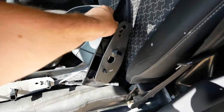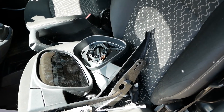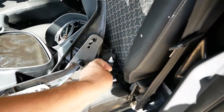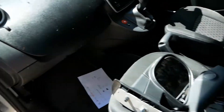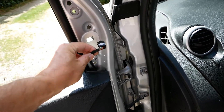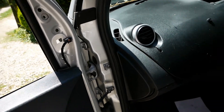There's no point having a mirror you can't even screw on — that lasted 30 seconds. I'll show you why: it's very easy to fit these mirrors. You pull that bit of trim off — it's held with just two clips — then you've got your two screws holding the mirror in, and you unplug the plug. It is literally a one-minute job to replace a mirror, if your mirror doesn't break on you.